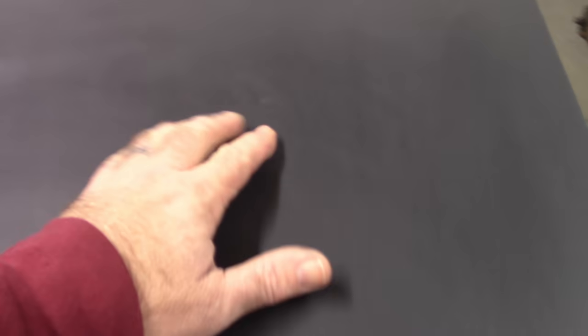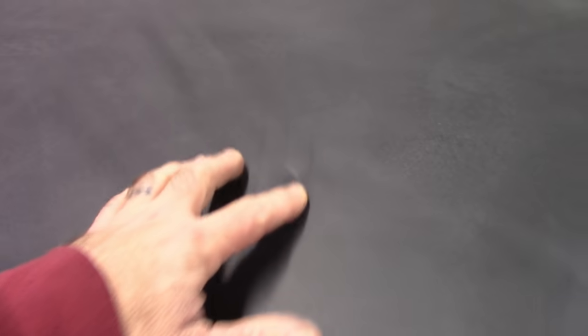There are a couple of dents. There's like one here, one there. I forget where the other one was. There's a very shallow one up here. But again, as I've shown in the previous videos where I've done this kind of repair work, I'll probably end up coating the whole thing. Now, it doesn't mean it's going to be an issue and be this thick with filler. It'll be very, very thin, but it takes care of any of those little dips and shallow spots and dents. That's probably the worst one, and that's really not that deep, but I'll get more into that.